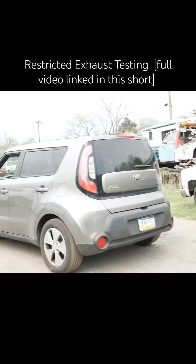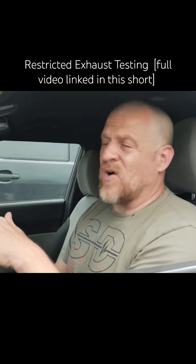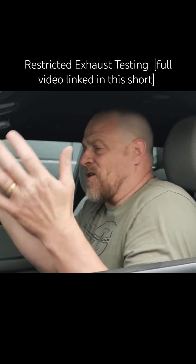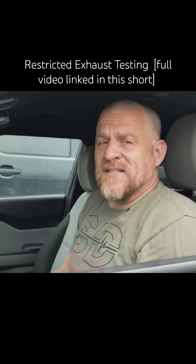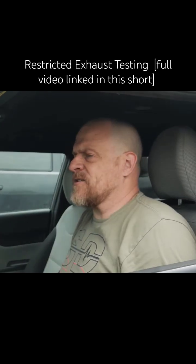So if you have something like this as a car owner, the first thing you can do without any testing at all: remove the upstream oxygen sensor, get it out of the exhaust to give it a place to breathe. Then see how you can drive it — that can actually be our first test. We'll scan it, do the other stuff, and go through the motions.